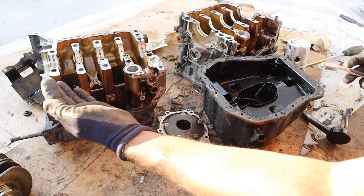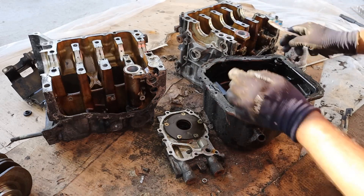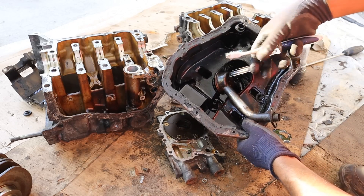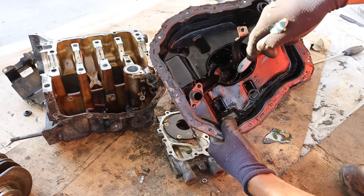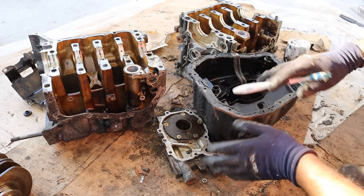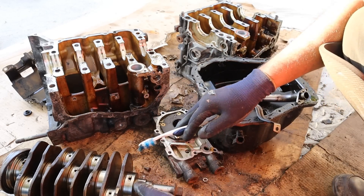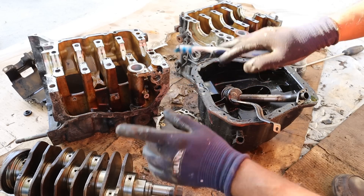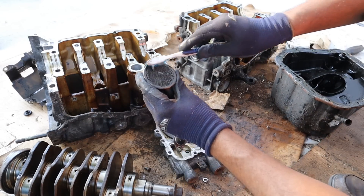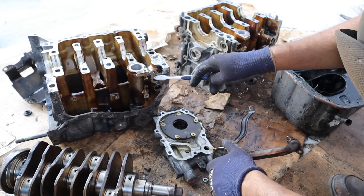One of the disadvantages to having the pistons horizontally opposed is that it takes a little while for oil to drain back from the sideways block down into the oil sump. That's why Subaru has tried to make a really deep oil pan and put the oil pickup tube very far down inside, buried in two separate layers of oil baffles — just to try to keep the oil covering the pickup so it doesn't suck up air, especially when sloshing around corners. There are still going to be people who neglect these engines and run them low on oil, and that's going to cause rod knock — very common on these Subaru EJ engines. So if you've got one, make sure you top up the oil very frequently. Now oil begins its journey from the oil pan through this oil pickup tube — I don't see any metal shards; I think it was just the milkshake inside that kind of totaled it out.